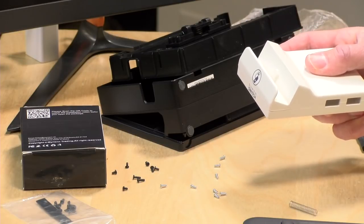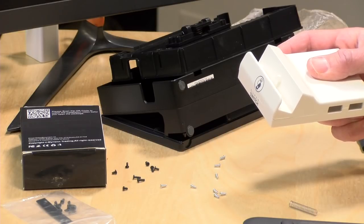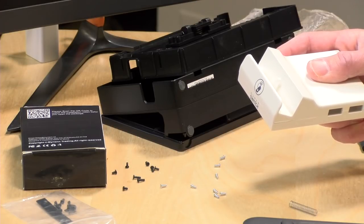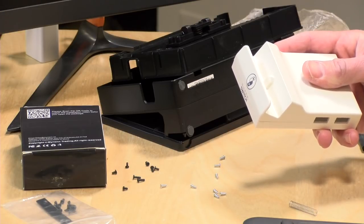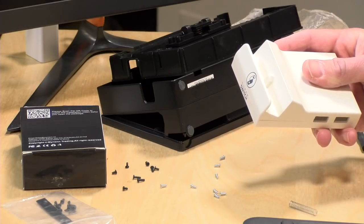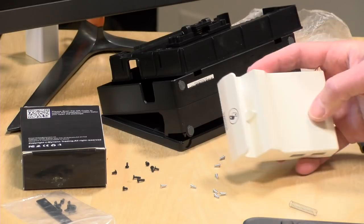So, all right, I'm just going to check the instructions here. Okay, so they have you do the motherboard first. And then they have you reconnect the connector, although we're going to reconnect it at the other end. And then you just put that thing in there and screw it down, it looks like. Okay. All right, so the screws we need for the motherboard, it's actually funny, there's fewer screws on the completion here than on the opening salvo. Okay, so you put that in there, I'm just watching this, and then take the 3 upper screws with the large screw. Okay. Oh, that's easy enough. You know, this may not take all that much longer.